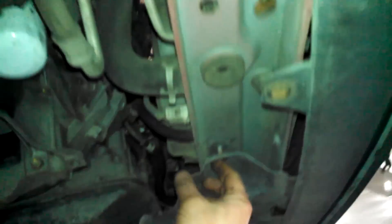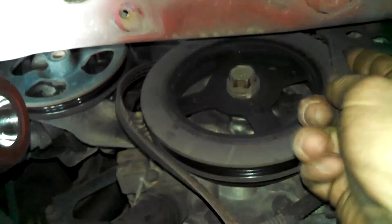There are 10 millimeter bolts in here, 10 millimeter bolts here, and a nut here to separate everything and get that out of the way to give you some access. Get up there — left to loosen, right to tighten. Go ahead and grab this belt and pull it down. You can maybe loosen that other bolt as well — it's probably a 14 as well — just to give it a little pivot. Pull it down to get the slack you need and take the belt off. And the belt is off.